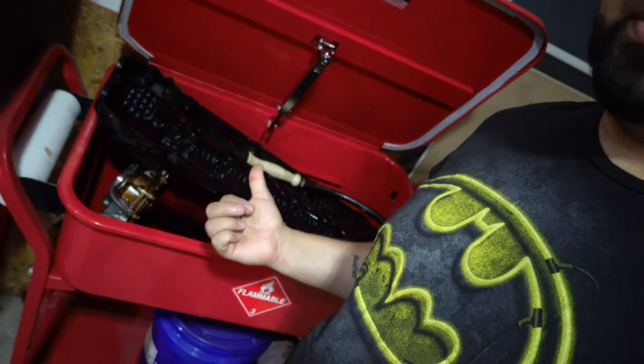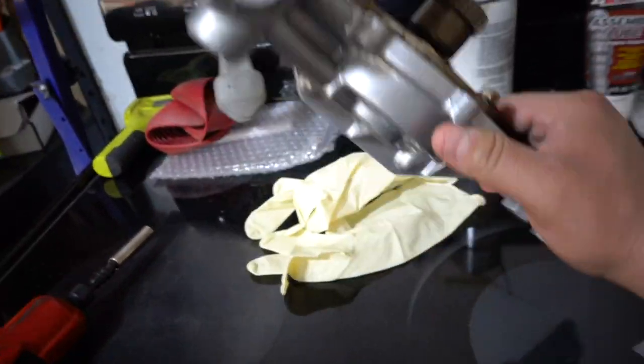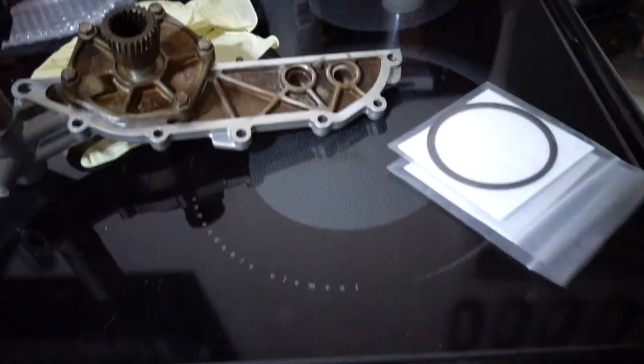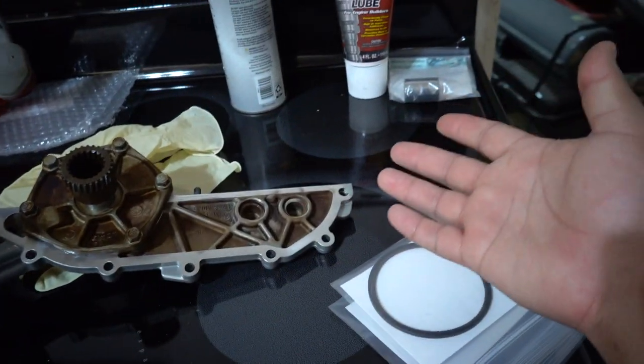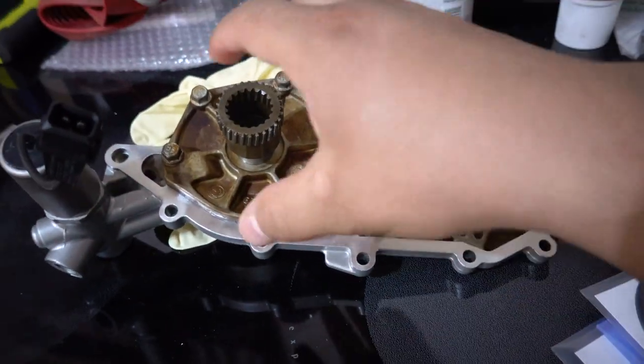I have the vanos system and the valve cover here in the parts washer but I want to let it dry on its own — it was very dirty. We're going to go ahead and do the single vanos first. When I'm editing this video I will post the timestamp where you can skip to the dual vanos section. Both systems have a lot of similarities but they're also kind of different, so this is why I'm doing both in this video. We're going to remove these 10mm bolts first, pop this out, and then the whole piston will come out.